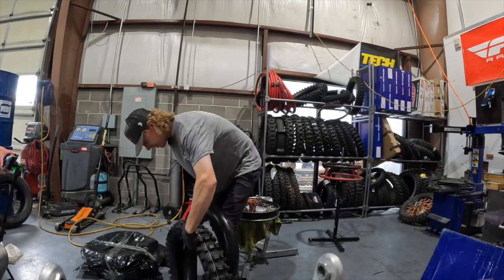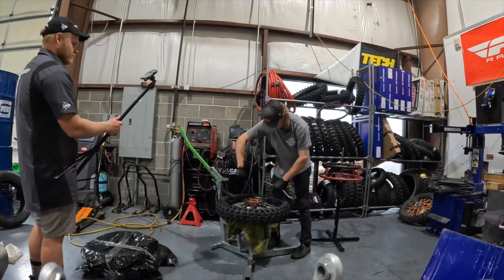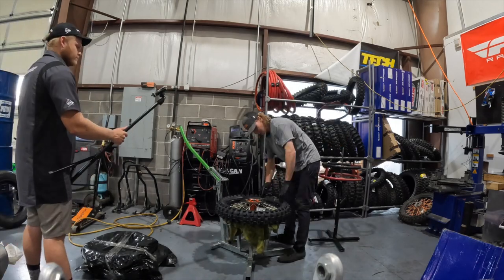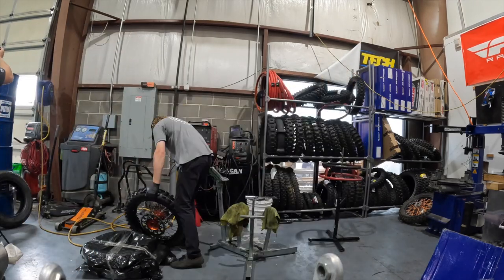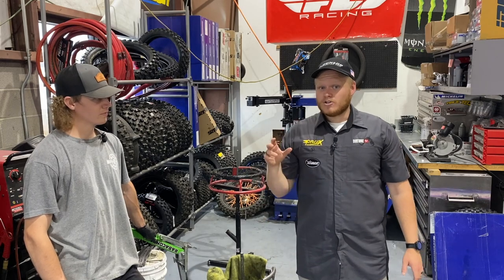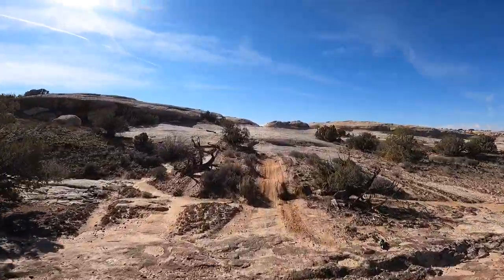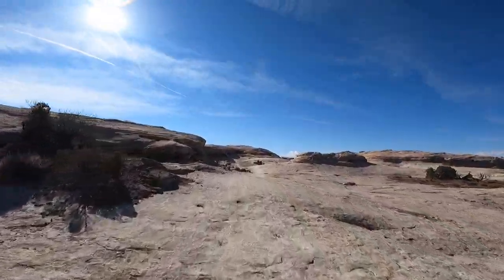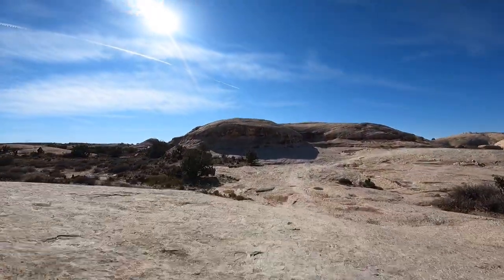We have a lot of videos talking about the pros and cons of tubes versus mousses. For a lot of guys, if you're just doing normal riding, you're cool with staying on the tube life and it's less maintenance. You do have to keep up on these — that's something people need to remember when they get a mousse. It's not like you can just leave it in there and all your problems are magically gone. You need to upkeep it — lubing it, making sure it's not too soft, making sure you're putting pieces in or putting a new mousse in pretty consistently. I've hopped on bikes of guys who have that mindset of 'it's a fix-all' and the bike feels like it has two flat tires. You have to weigh out whether you really want to commit to the maintenance that mousses require.